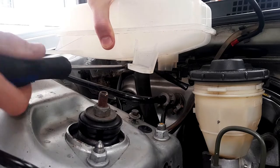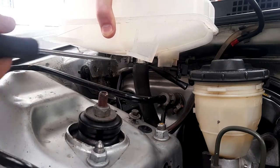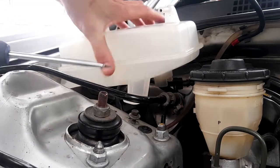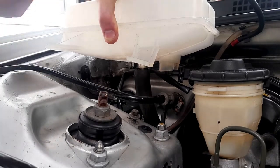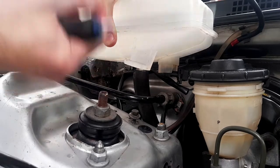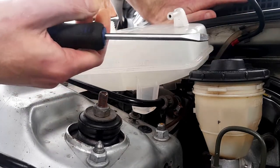Somebody asked me the other day, Jubilee hose clamps or these sort of automatic spring clamps. Well, Jubilee clips are easier to apply with a screwdriver or 7mm socket, but they can be subject to abuse, like over-tightening, under-tightening. Cheap ones tend to cross-thread and then cause massive leaks, whereas the spring clamps are a faff to get on and off, but they are designed in a way that they can apply enough pressure to not create any leaks, but not enough pressure to cause damage to the hose or over crimping and basically crushing of the rubber itself over time.